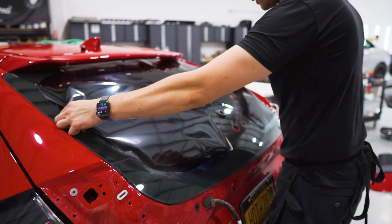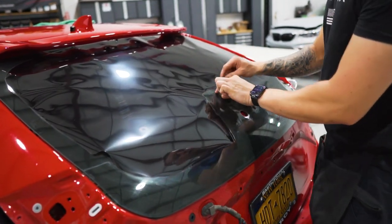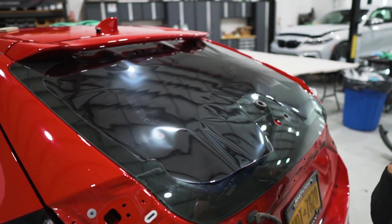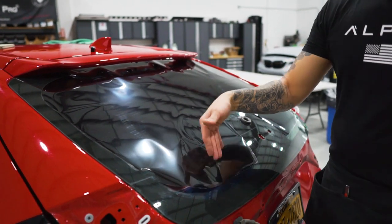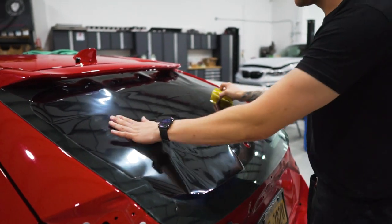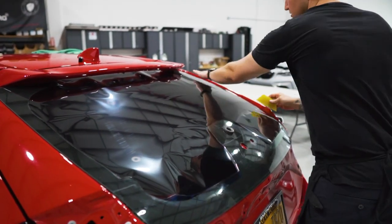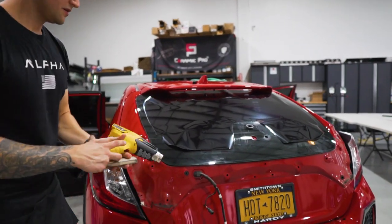When I lay the film on the back window after taking the wing off, I lay it about an inch higher than where it should be. Because on the bottom, a lot of material ends up down here and you have a lot to shrink. Shifting it up a little makes it easier. After I shrink it, I'll spray water, wet-mount it exactly in place, and then shrink those remaining high-tension points where fingers pop up. When doing an H pattern, I mount it a little lower so more material goes up than down, making the bottom easier to shrink.